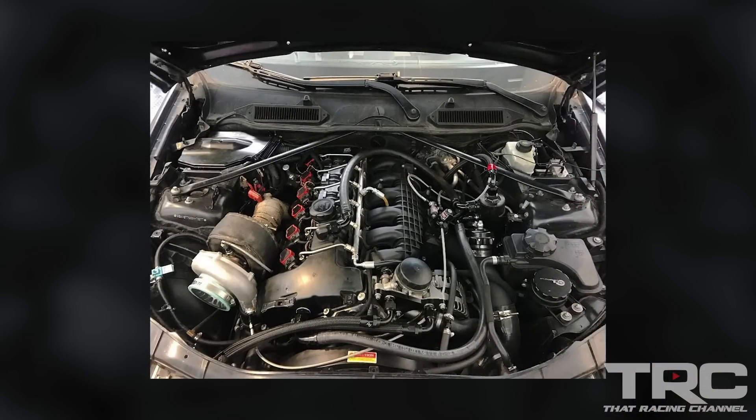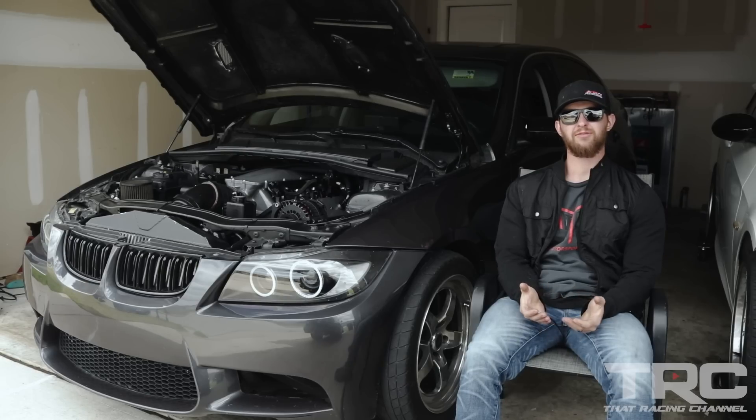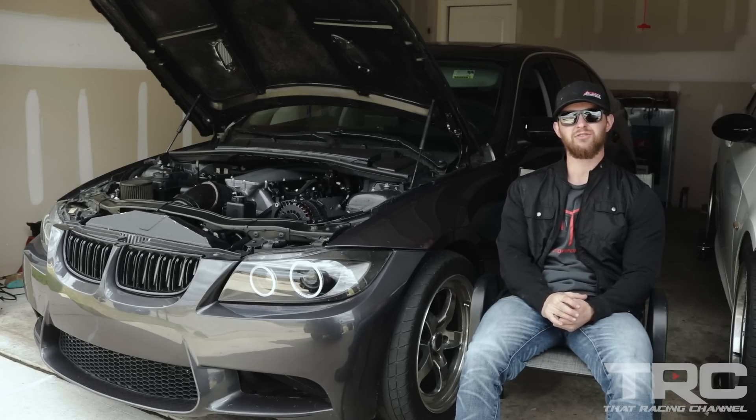Picked the car up four or five years ago — typical E90 stuff, full bolt-on E85, good time. Wanted a little more, put a single on it, tapped out the turbo, put a Precision 67-66 on it. Had fun with the manual trans for a little while, ended up bending three rods, so put rod and pistons in the motor. Right after that put a 4L80 in the car, did some drag racing — it went bottom tens consistently, almost like a bracket car. Ended up putting nitrous on it, sprayed a 100 shot, car went 9.91 at 139. Decided LS makes more power, most reliable way to do it. Found this guy Michael Page — LSx E9x, which wasn't really a thing at the time. He cut me some mounts, transmission mount, motor mounts. Put a 5.3 in the car naturally aspirated, then wanted to do a blower. Bought a very large ProCharger — just didn't make power, we narrowed it down to the headers being too small. So put twins on the 5.3.